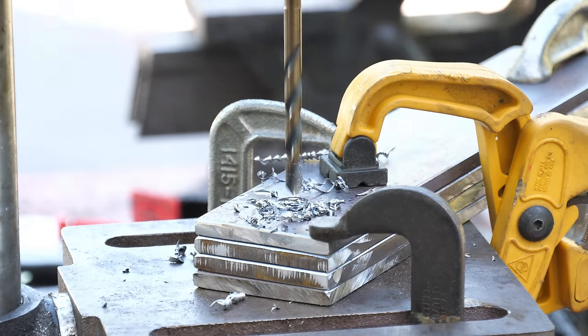I have my old nasty exhaust clamp, so I tried to clean them up a little bit. We'll also be reusing the collector gaskets. These are just solid aluminum ones, and I'll clean them up a little bit with some like 220 grit sandpaper. Oh, and I have a new pair of these snap grommets, that's what they call them, since we were missing one of the old ones that fell out, and the one that was left is kind of smashed and gross. And with all that prep work done, the exhaust is ready to reinstall, hopefully for good this time.